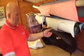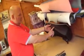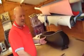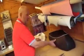but before you do it, just put a staple through. After you've stripped it, put a staple through. Make sure that it doesn't actually come through the depth of the plastic. If it comes through, then you know the staple you've got is too long before you fit the cover and put a hole in it.